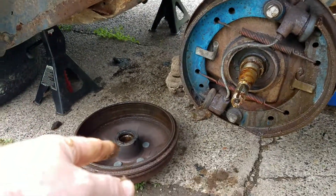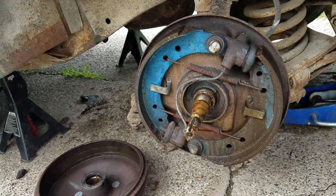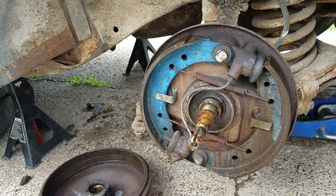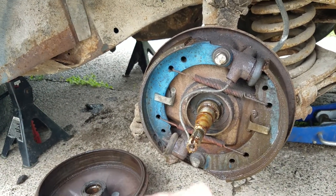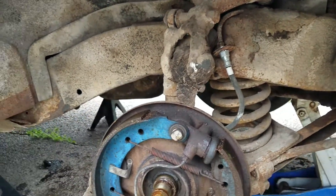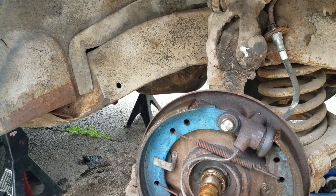This is a great time to look at all your bearings and seals and everything. Make sure your shaft's good, re-grease everything, re-pack your bearings and do all that. Clearly I need to clean some crap up because of leaking brake fluid. But yeah, that's pretty much how it's done. I know, luckily, I already replaced that line a couple years ago, so I shouldn't have to worry about that. That's not too big of a job to do either.